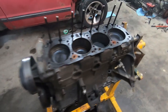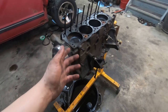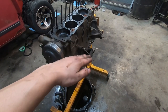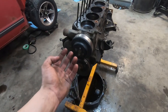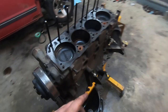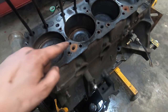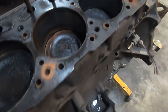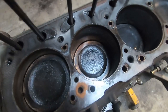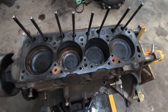First look, it doesn't look that bad. When I was driving it before around 16 to 18 pounds of boost, you'd floor it and you could hear the engine make this awful noise. I figured it was lifting the head, because you'd back off the throttle and it would speed up. That could be all these wet spots in the middle — pressure leaking between cylinders, or this one right here looks very suspect of air getting out. But combustion-wise, it actually wasn't that bad. There's lots of oil in there, that's for damn sure.